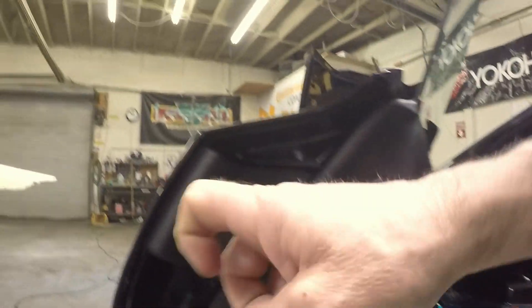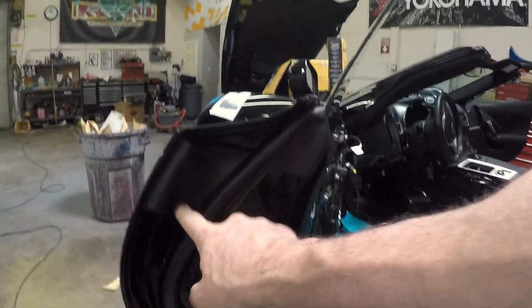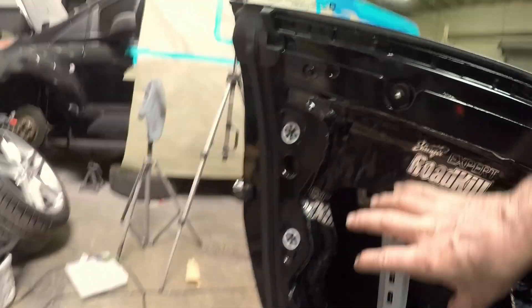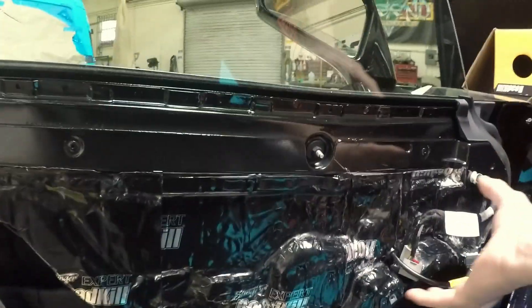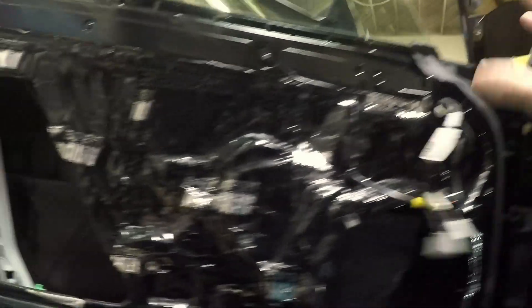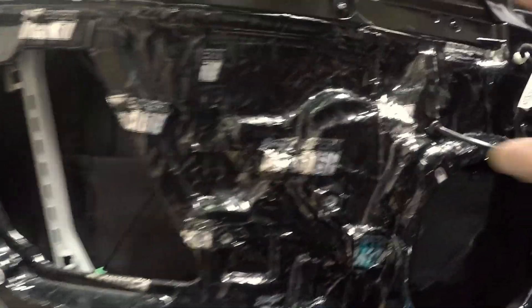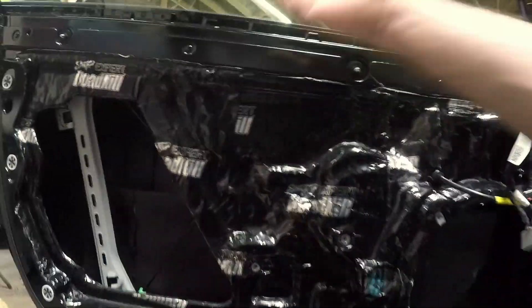This is a GM car plastic — you can hear that little plastic rattling, so I've got to fix that and make sure it doesn't rattle. The energy coming from this 10-inch driver is going to be enormous. Once I get all this done and everything closed up, this is going to be an actual panel that bolts on so you can get access. Once that's done, I'm probably going to put egg crate foam in here so that the egg crate touches the panel to try to dissipate all the energy that the panel itself is going to produce.